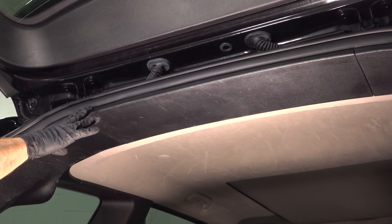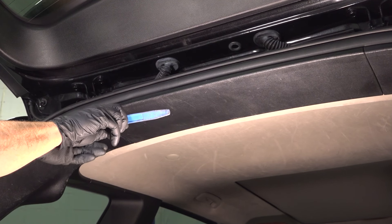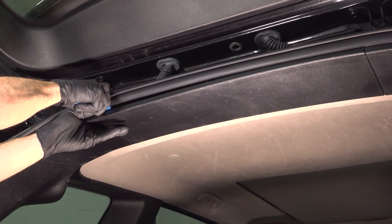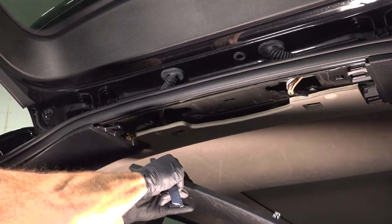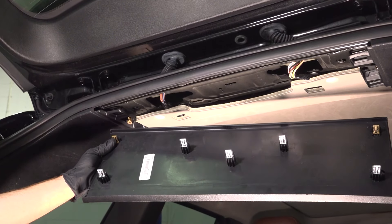To gain access to the electrical connector, we're going to have to make our way behind this trim panel. We don't have to remove too many trim panels, but we do have to remove the upper trim panel from this area. To get this out of here, we can use a plastic trim tool — come up along the seal and gently pry in between, separating this. We'll pull that down and out of place, do a quick inspection, and set it aside.